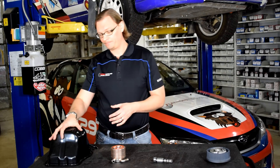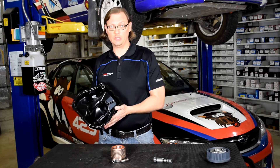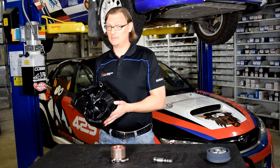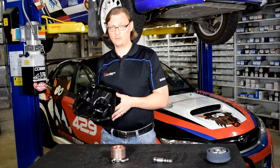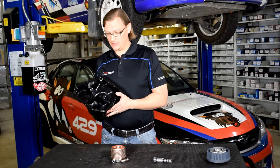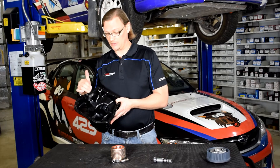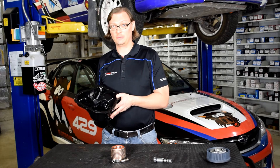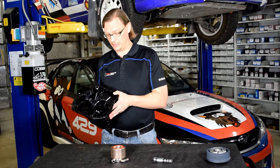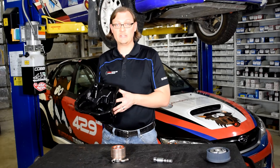One of the starting points is the oil pan. Generally speaking, this is something that can be cleaned out and reused, but it's not something that can just be quickly moved over to the new engine. If you're going to reuse an oil pan, you've got to be 100% sure that you can get underneath the baffles and everything to thoroughly clean it, so that none of that contaminated oil will transfer into the new engine. If you're not 100% sure you can clean it thoroughly enough, replacing it would not be a bad idea.